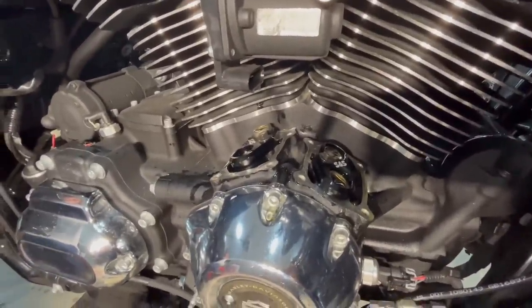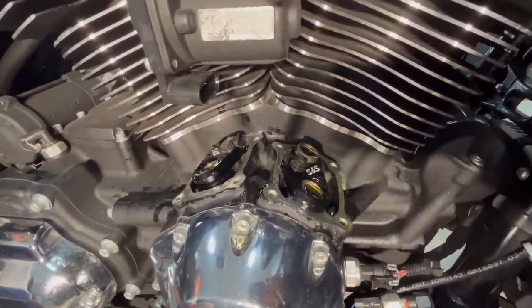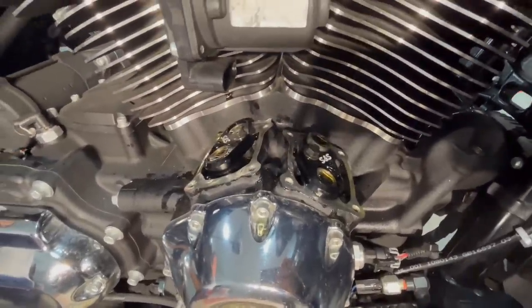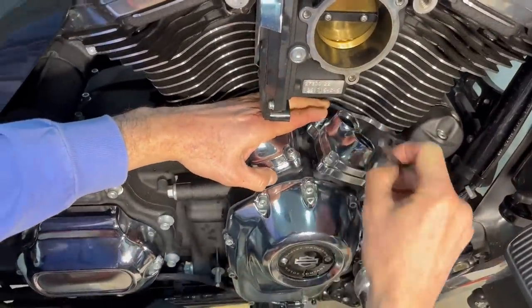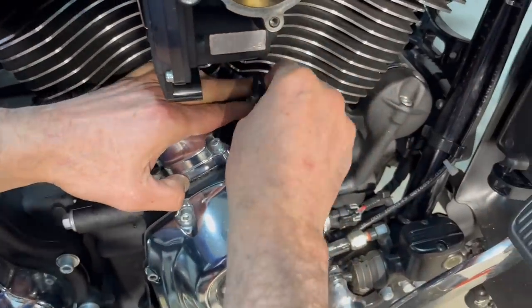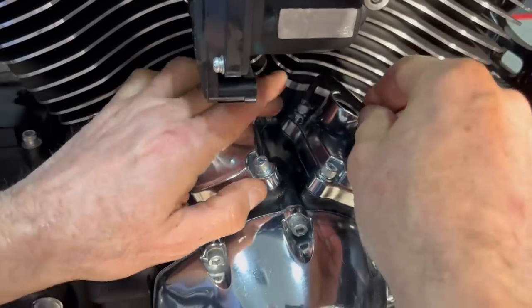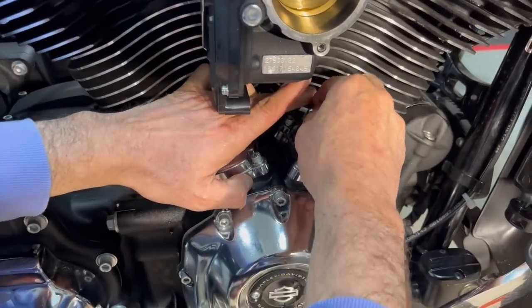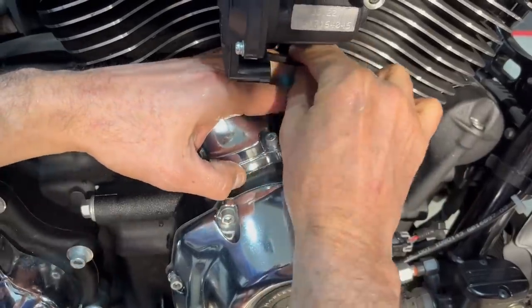What we're doing now, after we tighten it, we're just moving it in sixth gear. We're moving the wheel, making sure that they're not touching, they're not binding, and there's free movement of the tappets, that they're not touching the covers. Okay, this actually, believe it or not, is the most tedious, time-consuming job, because it's getting access to this Allen bolt all the way in the back, and every time I'm engaging it, it goes a quarter of a turn. So when I count down to three, that's when we're going to go fast forward. One, two, three. Okay.